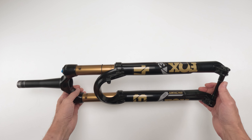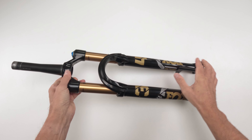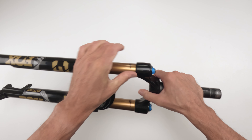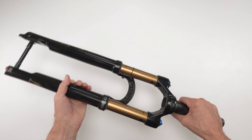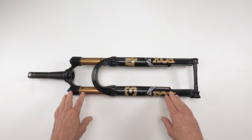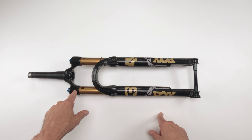This fork came from a subscriber and to say the least, it has some issues. For starters, the damper is making all sorts of crazy noises. Two, the low speed compression knob doesn't want to turn at all — the high speed compression turns, but the low speed compression doesn't. And three, the wiper on the air side looks like it's definitely seen better days. So we are going to be doing a full service — full 50 hour, full air spring, and complete damper service. This video is probably going to be a little bit long because I'm going to completely take apart that damper in order to find out why that knob doesn't work.